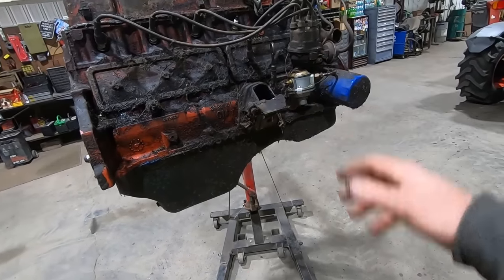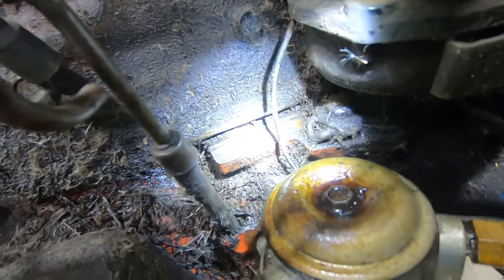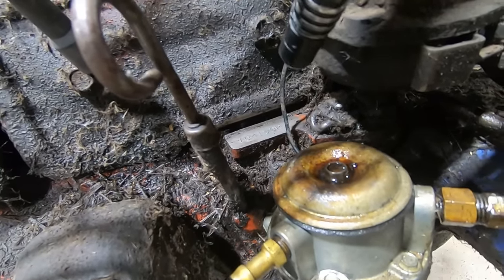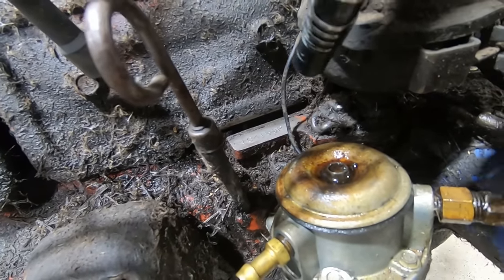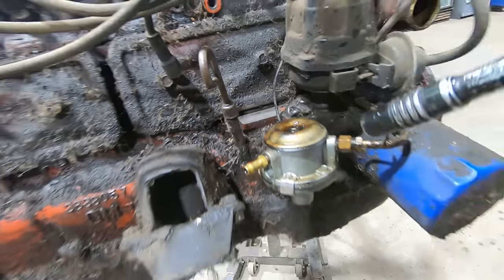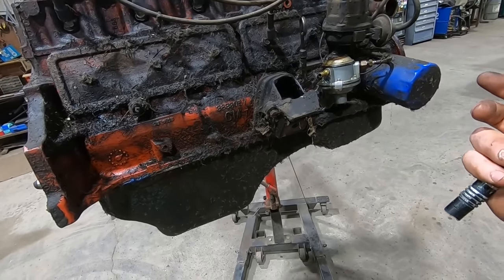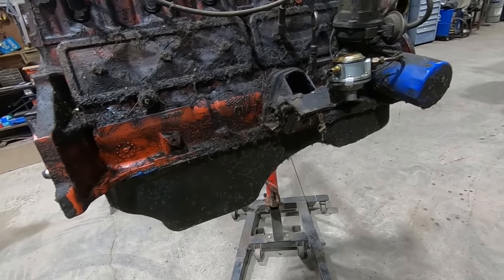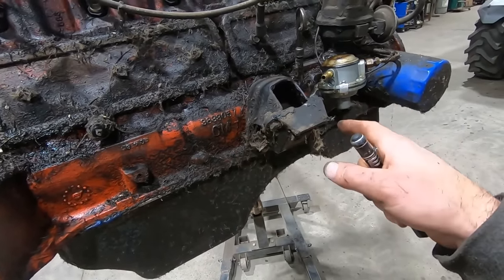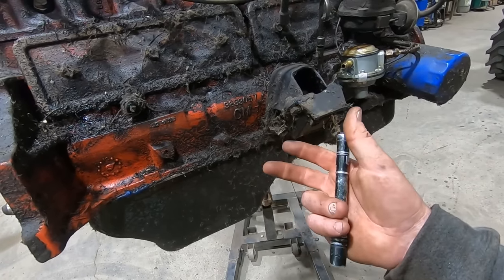And then I was like, wow, we gotta figure out what this engine is. So we checked out this code, T0415OR. T is Tonawanda, New York, engine facility. 04 is April 15th. Isn't that tax day? And then 0R comes up as 64 to 67, 194. So it's a little baby engine, not even a 230 or a 250. And in front of a Powerglide, which explains the clutch linkage on the other side, this was a Powerglide engine. Maybe they just used a different linkage on the, sounds like these only came in Novas and Chevelles.